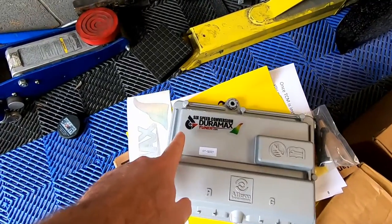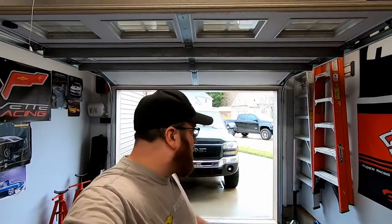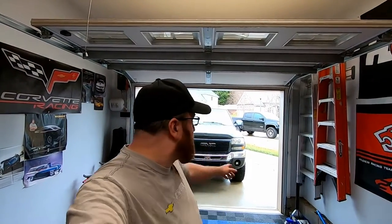On the TCM you guys can read it - it does say six speed conversion by Duramax Tuner. So we're going to be converting the Allison transmission in our Duramax to a six speed. You guys might be wondering, well don't you have a six speed? No, I don't actually. The LLY - I think 2001 to 2005, maybe even 2006 - the 01-05 definitely all have the Allison 1000 transmission but they're all five speeds. You might be wondering well how are you going to make it a six speed? For whatever reason when GM developed this transmission with Allison they had a sixth gear in there.